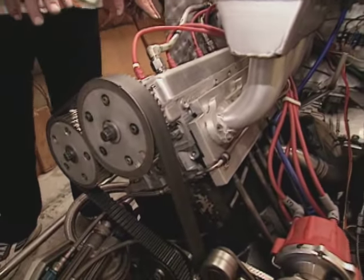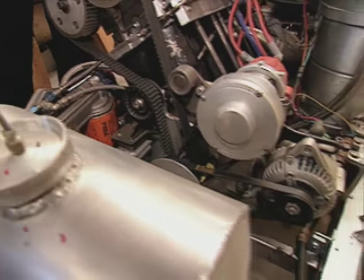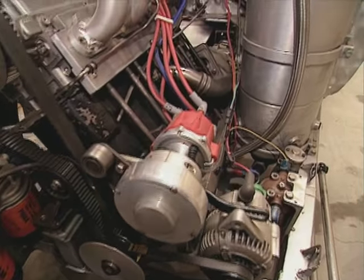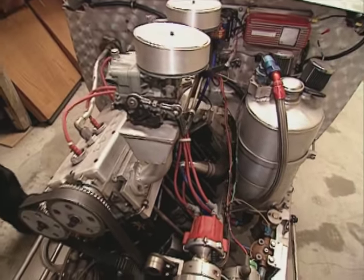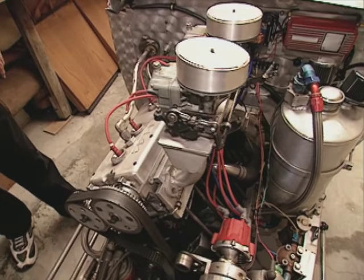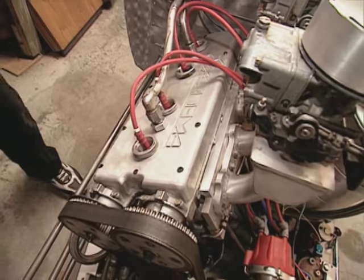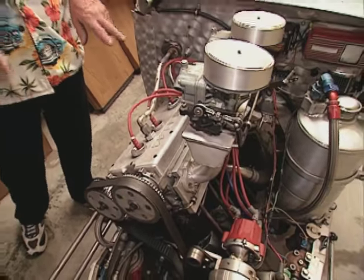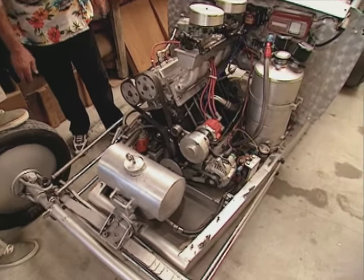It's got two Subaru heads welded together front to back with new Snyder cams, Crower crank, Crower rods. Four valves per? Four valves, twin cam. So are those like WRX heads? They're WRX heads, yes. Those are mean machines to begin with. They're good heads. The best head you can get, it's a two-cylinder head, and the Model A is two and two, two side by side with a big gap in the middle. So that's why you had to mate them, right?